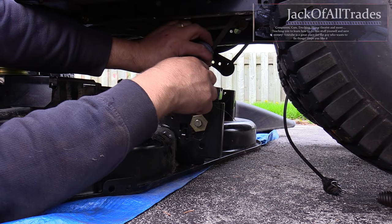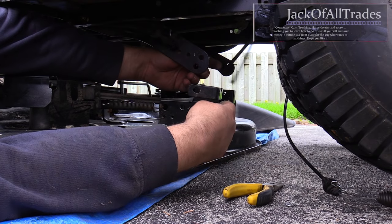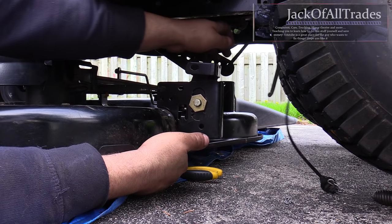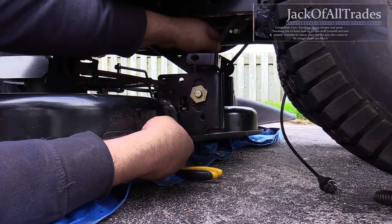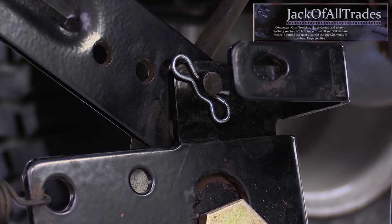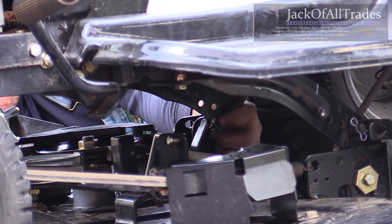On the back here, you're going to remove the cotter pin — just pop it out like that. There's a bar behind that just slides out; grab that bar and slide it toward the tire. Insert it in the hole shown — there are a couple of holes, see the hole I just put it in. Lift the mower deck up, line up the holes, and pop it in. Grab the pin, put it back in, and that'll hold it from falling down. That's what it looks like — all the bars layered inside the steel, pin through it and blocked. Now on the other side, just reach up and fit it in the same way.